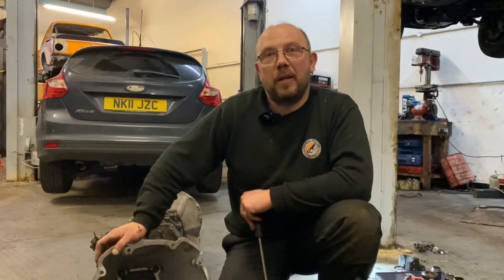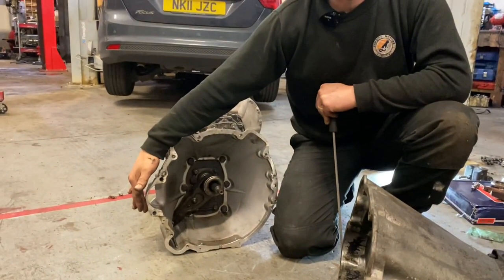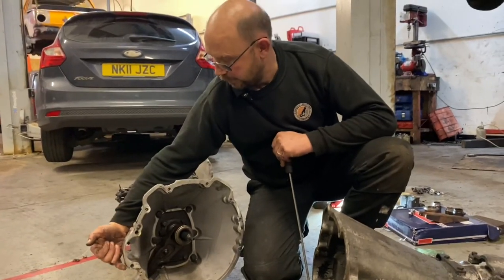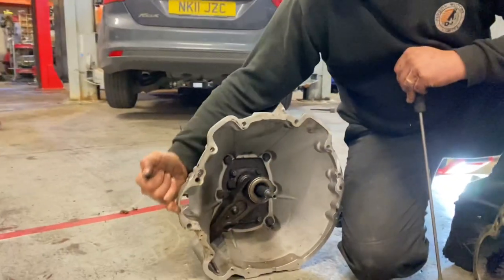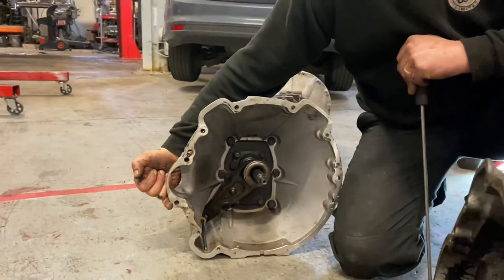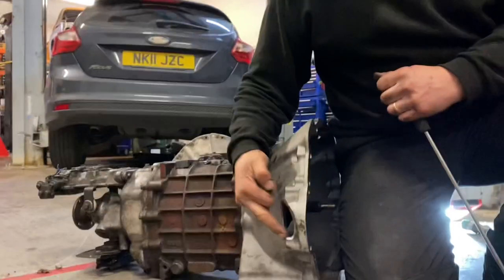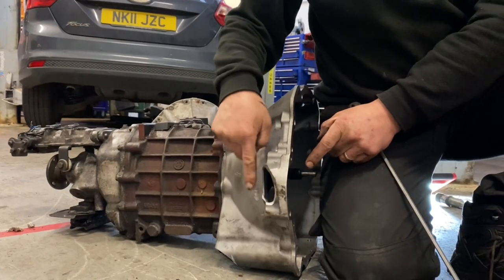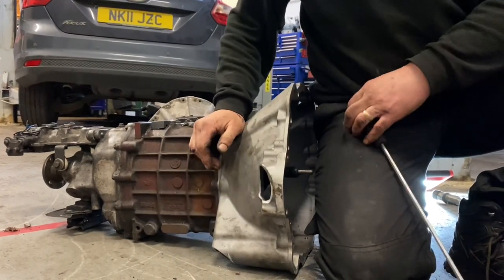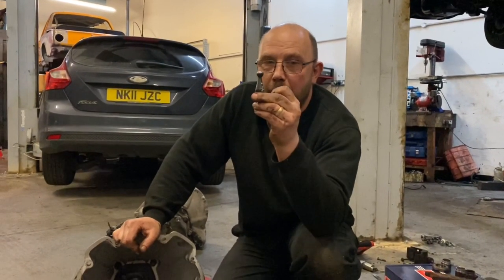While I was under the car just now I pointed out the area that is tightest clearance to the body. To that end we remove some material from the bellhousing - it was a bit wider there so we just slim it down and it makes it easier to get the box in and out. Not strictly necessary, but we also notch a bit off the lump or the corner - that corner was originally squarer. We knock it off, and again it makes it a little bit easier getting the box in and out.